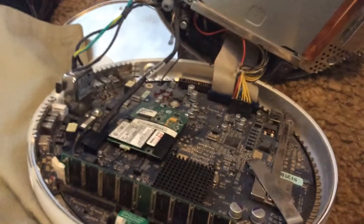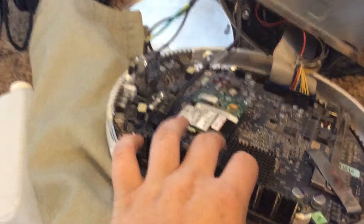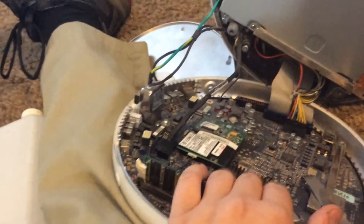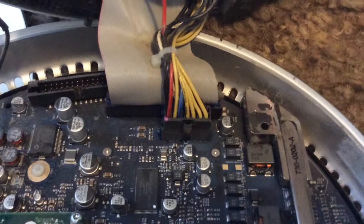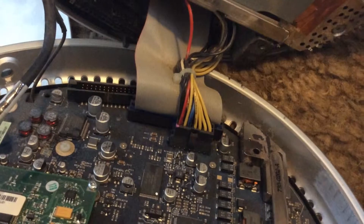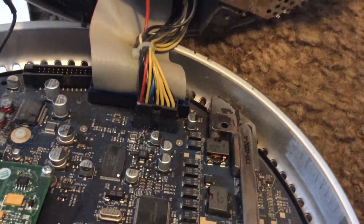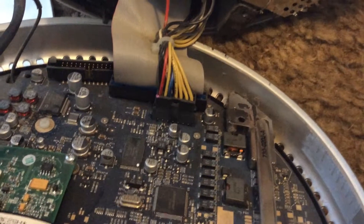Now that we have our second stick of RAM in, you're wondering: why are you redoing the thermal paste? Why not just leave it alone? Well, you can see right here — this is the heatsink and this is your processor, the PowerPC G4, I would assume. You follow the heat tubing down, and when you take apart this thing, you split apart the thermal compound. Meaning you have to re-apply it — you need to clean off that area and redo the thermal paste. Because Apple decided to make it hard for those of us who like fixing things ourselves.